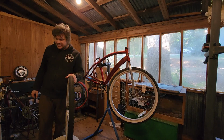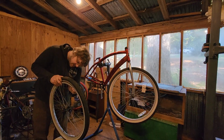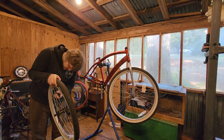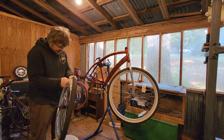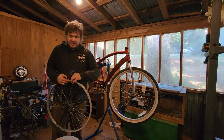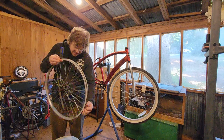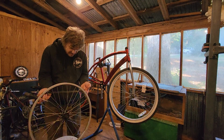I'm going to change the tires. One side, lock it down. Now just use the other one and off it comes. Ooh. That's the wheel liner, isn't it? Oh dang, that's not good. The inside of this is way more decrepit than I thought. The inner tube's still good, but that tire liner is toast. Take a screwdriver, put it through where the valve goes, and that should keep the new liner in place while you put it on the tire or wheel.